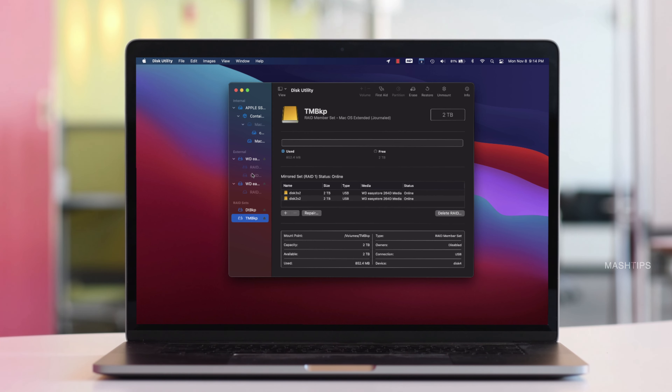Even though this is an easy solution, I would 100% recommend this configuration. I would always recommend having a dedicated disk for your Time Machine backup rather than using the same hard disk for data and Time Machine. This is not a bulletproof solution to protect your personal data, but as an average user, this is the best cost-effective solution you can set up with your Mac. If you are going to configure the same setup with an SSD drive, I would recommend using the APFS file system.